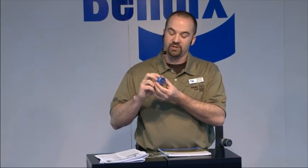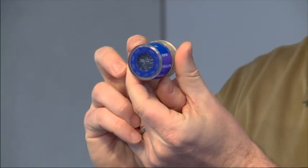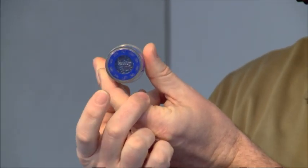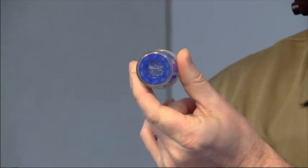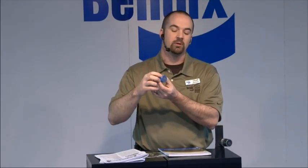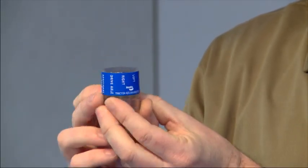Once you figure out what you have — let's say your left front sensor is bad — you go out to your truck, replace the sensor, do your troubleshooting. When you come back to the controller, there's a Bendix logo in the center with a magnet behind it — it's a magnetic reset. Put a magnet to it, all the lights will light up; take the magnet away and the lights will chase around in circles as it runs self-diagnostics again. If your fault is gone and the issue is repaired, you'll have your green lamp back. If faults remain, you'll see red lights telling you exactly what's wrong.